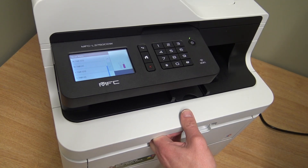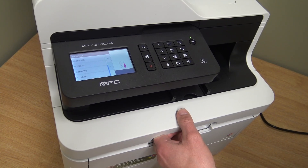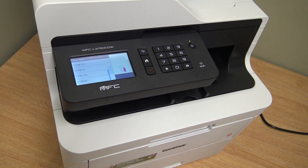You've also got magenta high capacity, yellow standard, and yellow high capacity. Keep in mind that resetting the toner cartridge makes the printer think you've fitted a new one. If this is just to get by, note that you'll start getting copy quality issues — toner also lubricates the drums, so this is really just a temporary option.